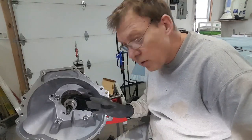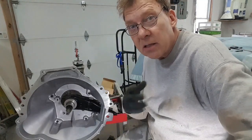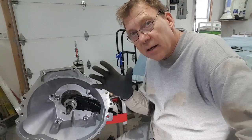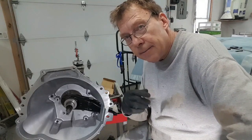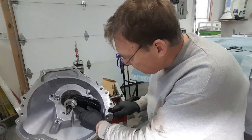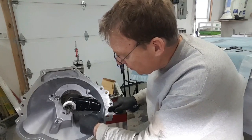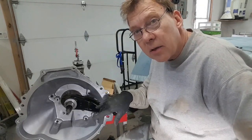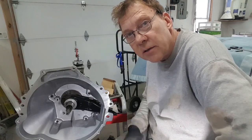So I'm in good shape here. What I'm going to do now is take some measurements and make sure all this looks good. I'm going to wait until the engine's together, then bolt the flywheel to the block, put the clutch pack on, and mount the transmission to the engine. But first, if this travel looks good — the fork travels to the end and won't overextend — that's right in the sweet spot. So I'm going to mark the block, mark the holes, drill it, and permanently install the block here onto this bell housing.